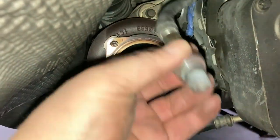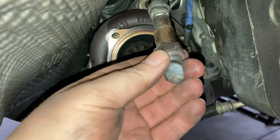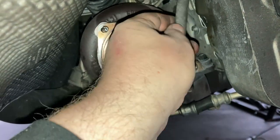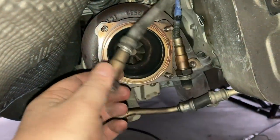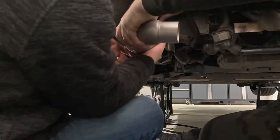And then finally, the O2 sensors, which you need a 22 millimeter wrench for. A little stiff to come off, and actually you're twisting against the plastic rubber hose around the sensor. So you get a little bit of resistance as you're twisting them out, but they weren't too difficult to pull out. But now we've got the cats off, the fun and games can continue. There we go.